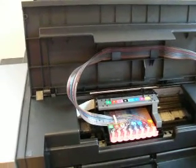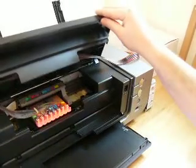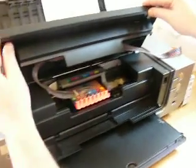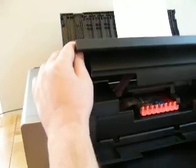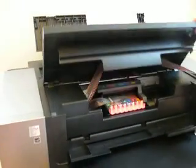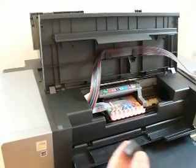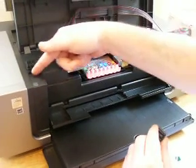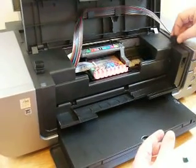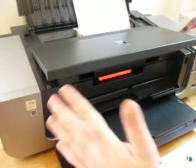Line your continuous ink system up at the side of the printer. Just ensure the cable isn't twisted — when you fold it down like that, you can see there's no twist. The next stage is to tuck this ink line in like that and then physically close the lid. You'll see some spacers — the purpose of these is to keep the lid raised to allow enough room for the ink line. These are going to be placed in line with the edge on both sides so the lid will sit on top of them. That's as far as it's going to go.